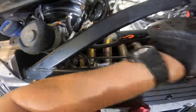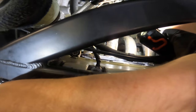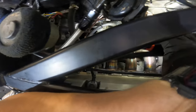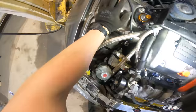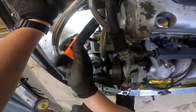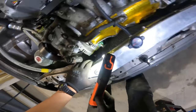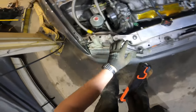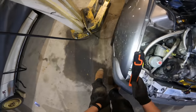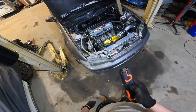So that power steering hose comes off there. Oh, it's quite a big tube, so I don't know if that'll be any good, but it comes off here and runs down the side of the engine through the chassis leg, I guess, comes back out here and goes into that cooler. So I think bumper off job. Well, I'm going to wheel it on the ramp just to make life a bit easier, but I think it's going to be a bumper off job.